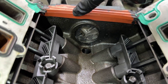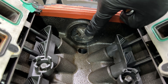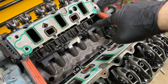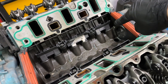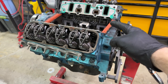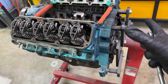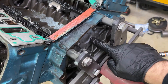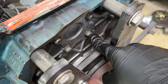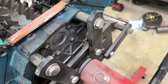Next, what I'm going to be tackling is the rear oiling. This was the balance shaft that we had cut off and RTV'd in. I'm going to remove it and make a permanent seal for the rear oiling hole up here. We're deleting the balance shaft — it's already deleted — but I want to make the oil blocking more permanent. Blocking the oil from the balance shaft provides more oil to the lifters. I'm also going to inspect the rear cover and possibly get a new one, because on the series 3 rear covers the oil crossover for the lifters has a deeper channel so more oil can get to them.